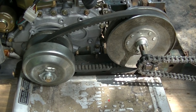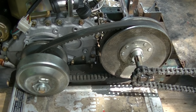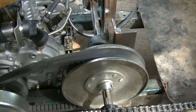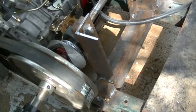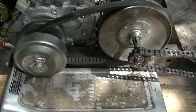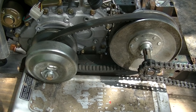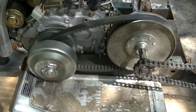There's your Comet Model 40 CVT — continuously variable transmission. Some people call it a torque converter; that's not really the proper technical term, but that's what folks know it as. The CVT is on the jackshaft, which is a piece of 3/4-inch shaft with two pillow block bearings on a couple of angle iron uprights on an angle iron crossmember. That center distance is measured very specifically. Whenever you're setting up a standalone CVT like a Comet 40, you have to get your distances perfect for the size belt you're using — you can't just guess it or the thing will not work properly. Trust me on this.